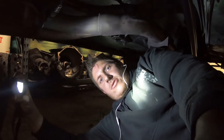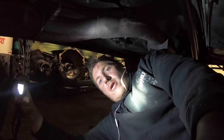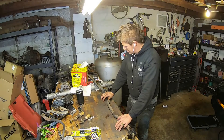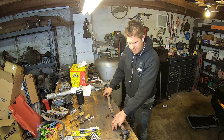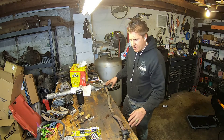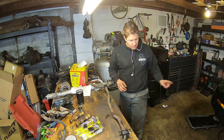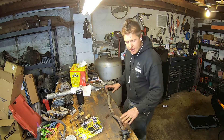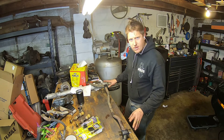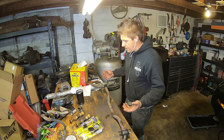So we've only got a couple things left to do. I've got to change the engine oil — that's quick and easy — and get the front sway bar bushings and sway bar links replaced. We've got the front sway bar out. We're going to get the old bushings off and then get the new bushings and new sway bar links installed. The oil is draining. We'll treat this sway bar just like the other one — get the old bushings off, polish up where the bushings ride to make sure all that corrosion is off so it doesn't prematurely wear the new urethane bushings, and then get it put back in.